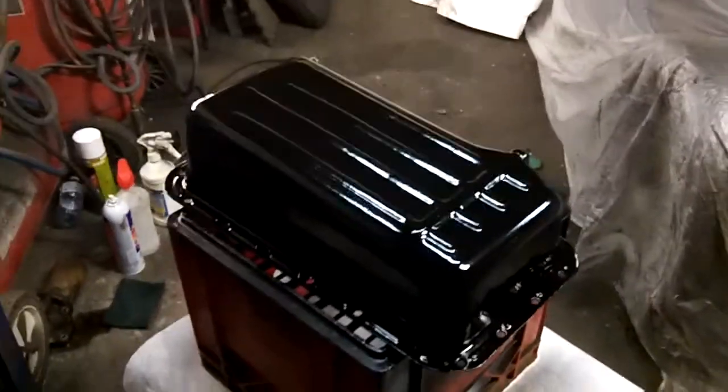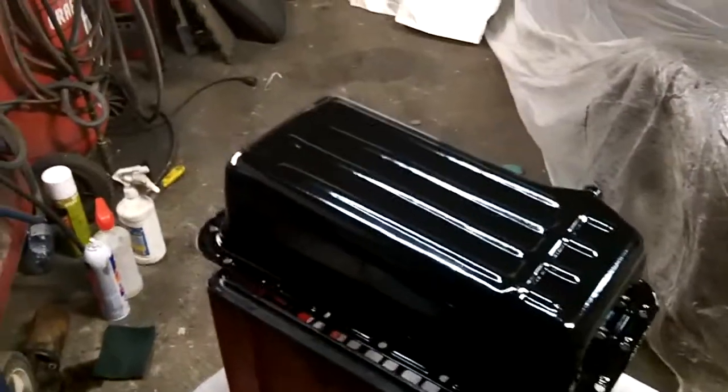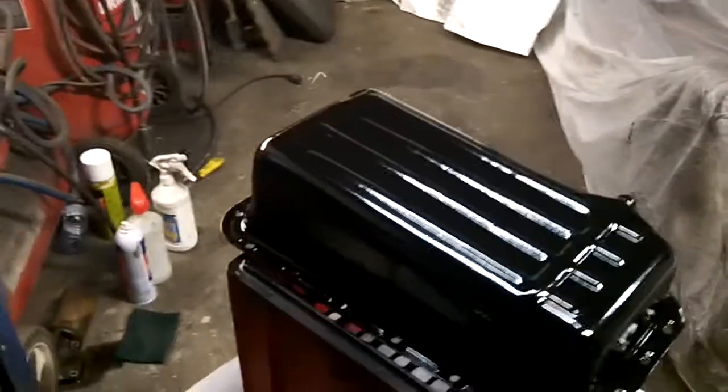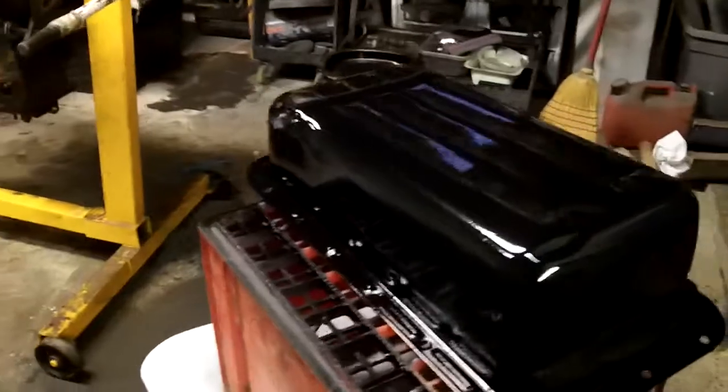Last update of the night, just after 10 o'clock, and we've got the oil pan painted — looks good. That's two light coats followed by one medium coat, per the can directions. All of that had to be done within the hour, or you'd have to wait seven days for it to cure before painting again. I think it looks pretty good — much, much better.